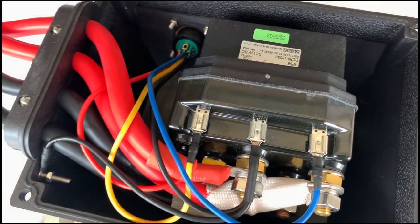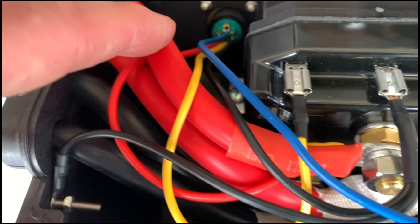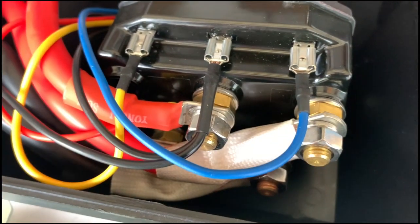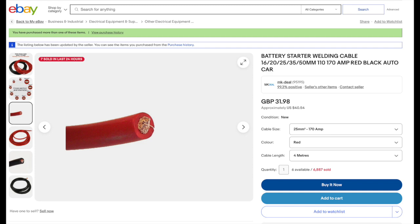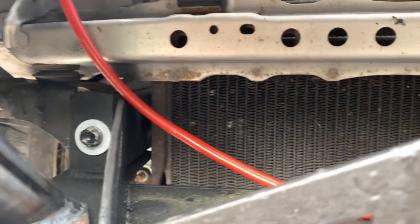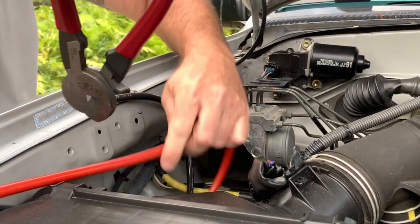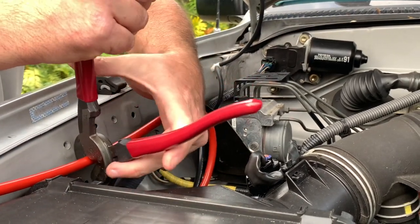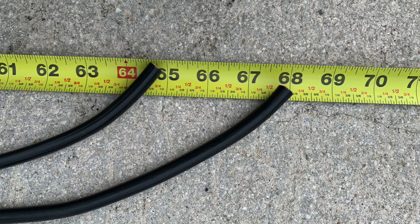The cables that come with the control box are too short to reach the winch, so I had to replace all the power and negative cables on the inside of the box. The cable I bought on eBay uses metric sizing because the winch comes from Australia — I went with 25 millimeter cables to match. I started routing the cables through, figuring out where I wanted them to run and how long I needed them. My initial cut was about 68 inches long, but I shortened them up later.